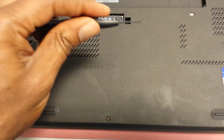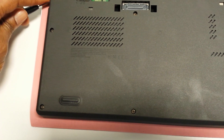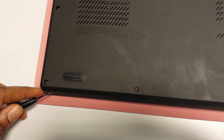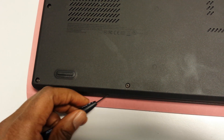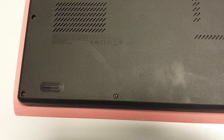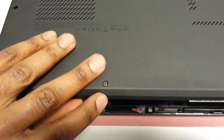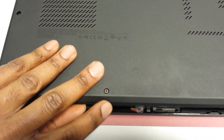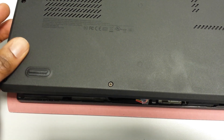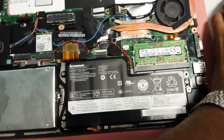So you're at the side — space it out and try to open it sideways. Be careful because it's an ultrabook. Once you've managed to do that, prise it open very, very gently. This is what I've done earlier, and then it reveals the inside of the machine.